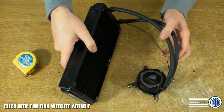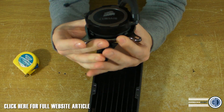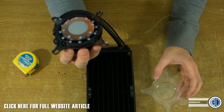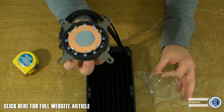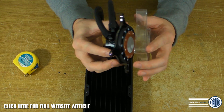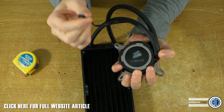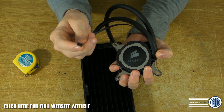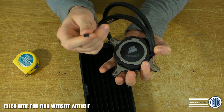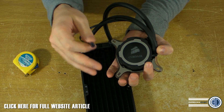So that's really it. The main thing to also mention is it does come with pre-applied thermal paste, so you don't necessarily need to replace it - but through force of habit, no matter whether it's a Corsair unit or any other branded unit, I always tend to replace it and put my own on there. No other reason than a bit of OCD. Also, this is the power connector - with these fixed power connectors it has got a three-pin so you could connect it to your motherboard, but I always plumb these directly into the Molex and put a full 12 volts to it. I've never noticed one of these units being loud enough to be a problem, and I certainly don't like spinning the pump down and back up, but that's personal choice.